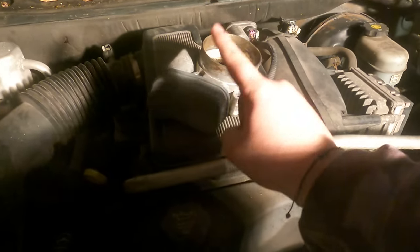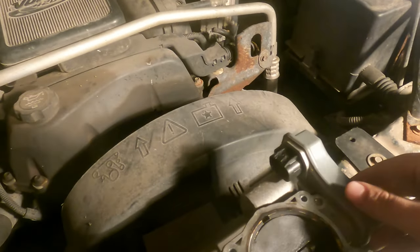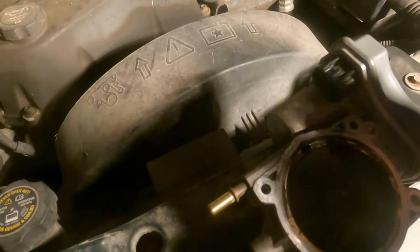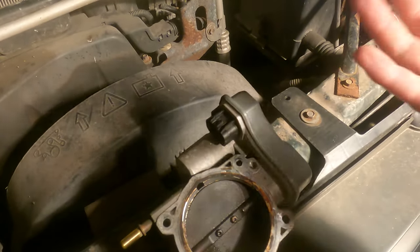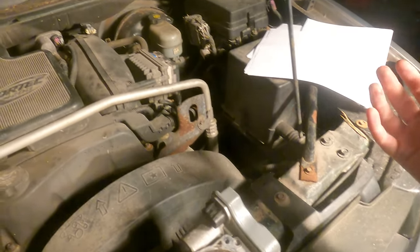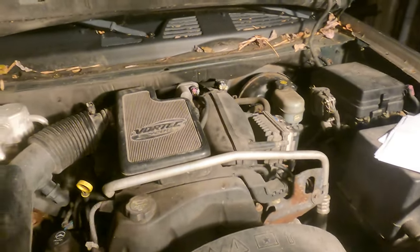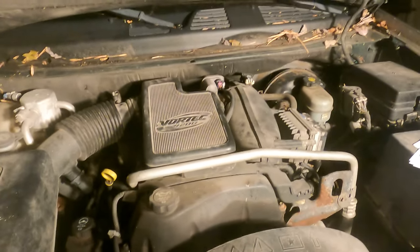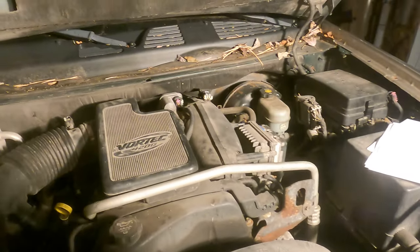The replacement is testing good. The test involves taking your multimeter — you want a little set of alligator clips so you can clip onto the pins — and then as you open and close the throttle body you'll get certain readings depending on whether it's good or not. For example, if you're seeing three to five k-ohms that's good; if it's below one k-ohm it's bad. There's a bunch of stuff like that, so check the link in the description if you're troubleshooting this issue.